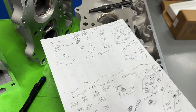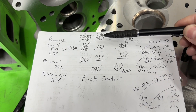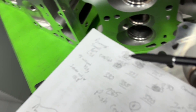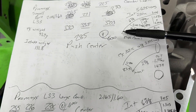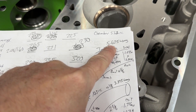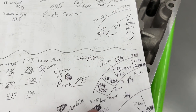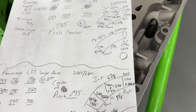For the nerds who want more information - great for cylinder head porters - this is a velocity profile over the short side. If you take a picture of the apex of the short side and look down the port, you get these numbers. The velocity at the pinch on the large bore is 295; the velocity at the pinch on the small bore is 285. As far as runner lengths: the small bore was 5.625 inches long and the large bore is 5.5 inches. I measured the bottom and top and averaged them for the centerline. Exhaust measured the same on both at 3.375 inches.